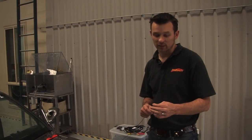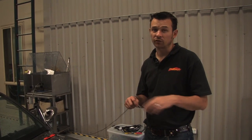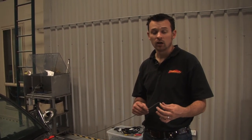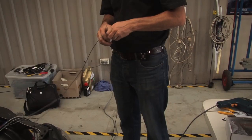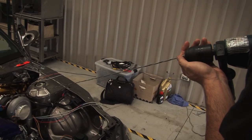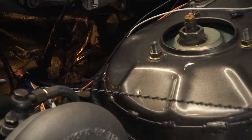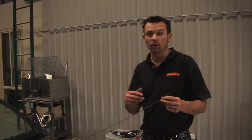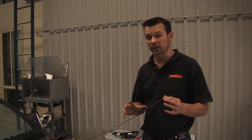To make for a clean installation, one tip I can give you is when we have two or three wires in one particular circuit — in this case the air temperature sensor — I'm going to connect a battery drill to the end of the wire and twist all the wires together, then heat shrink the whole wire. This looks good and also helps minimize the amount of electrical noise you get on the circuit.